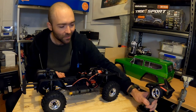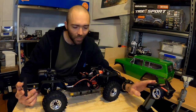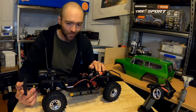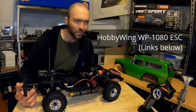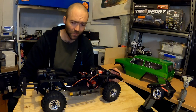So what I'd like to see would be better control. You could swap the radio out, you could swap the motor out, and I probably will do both of those things. But I wonder whether just sticking a 1080 ESC in this thing and dropping the punch would make a big difference.